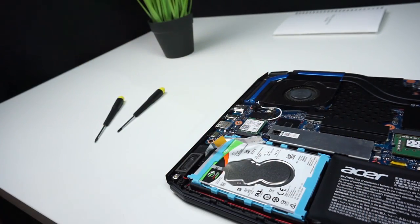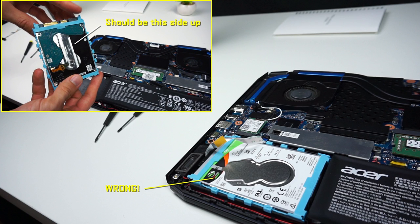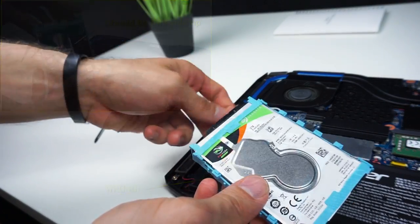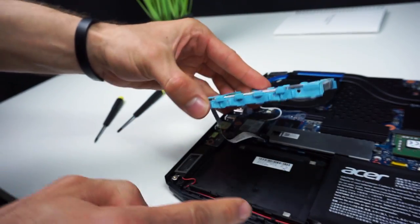I made one mistake when I was recording because I fit the drive inside the drive bay with the top side up. Simply ignore what I did and put the drive upside down so its bottom and pins are on the top. The cable should be above the drive and you have to match the rubber with the ridges.